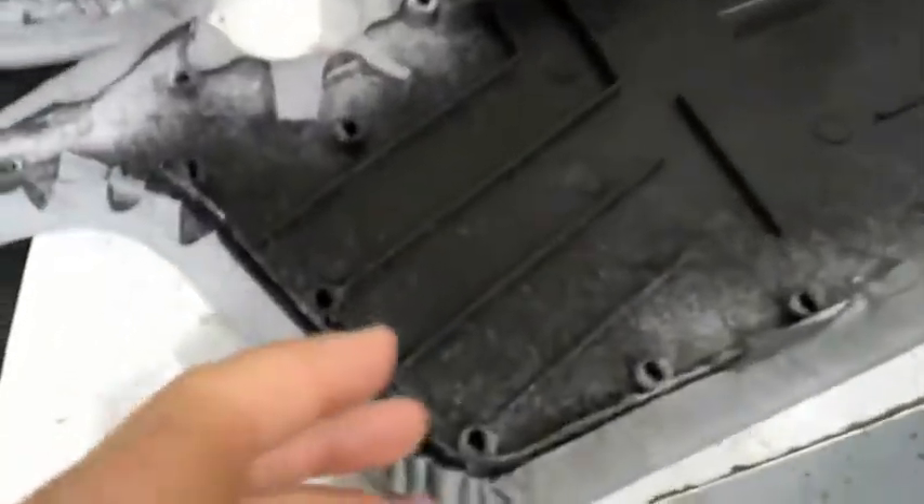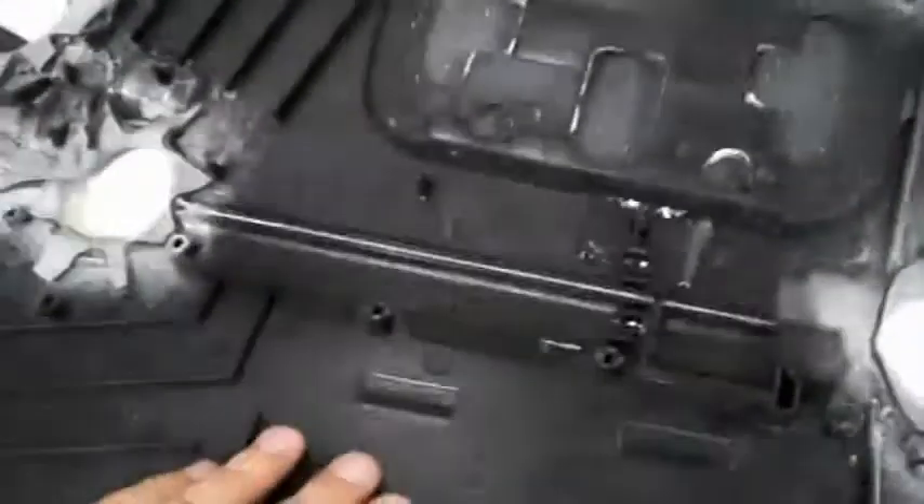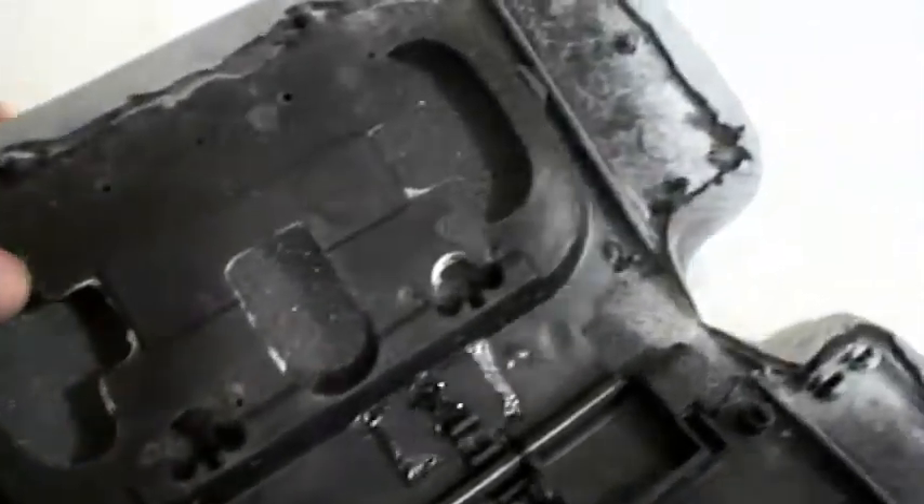What I've done here is taken the suede and headliner material and glued it along the edge of my visor. If I flip this over you'll see that it's basically not glued to the front side of the visor, just like the factory one wasn't glued. So now all I've got to do is cut the area out for the mirror, remold that in with the plastic welder, put this back together, then use the snaps to snap it back in and reinstall it.